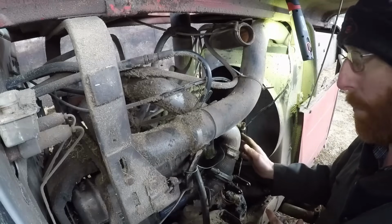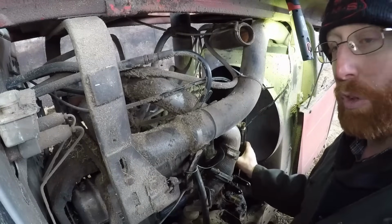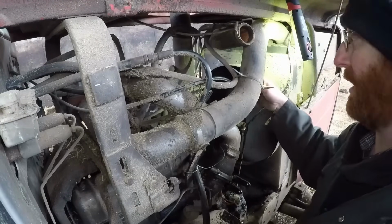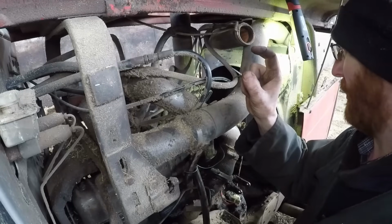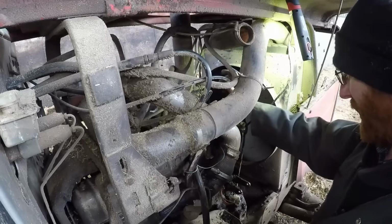The actual pump casting is bolted to a steel back plate. There's a couple of bolts still in that back plate, but it will come away now. The problem is we have sheared a bolt into the block on the far bottom corner. When we get the pump off, there will be a stub left sticking out, so it could be worse, but it's bad enough. Anyway, we are now free.